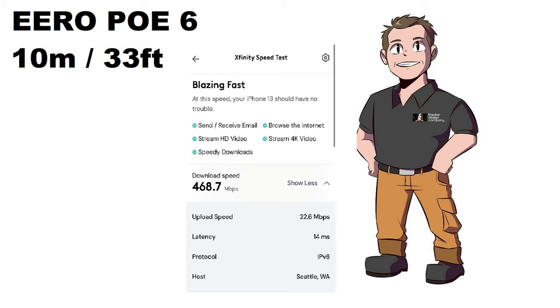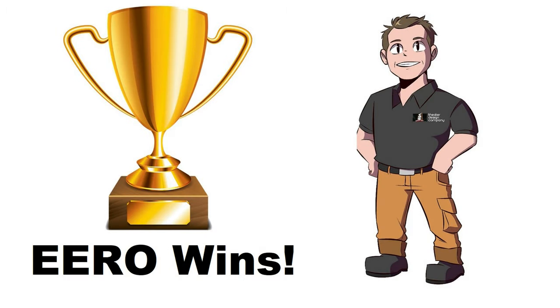Comparing two similar-price devices — UniFi 6 versus Eero POE 6 — we're getting 468.7 versus about 370, so roughly 100 megs faster with the Eero. The big benefit for a custom install like ours: Eero wins in every case. Much easier installer base, we can transfer the network to the homeowner simply, we can still use Eero Insights to see all our customers and check for issues. The Eero app is super simple; the UniFi app is basically useless.